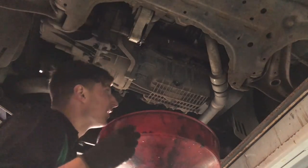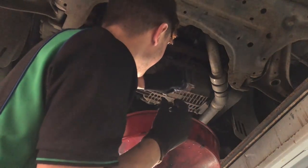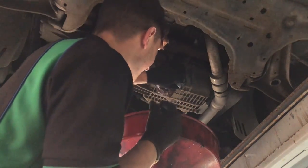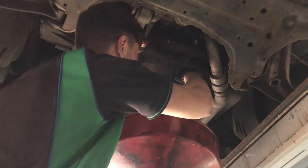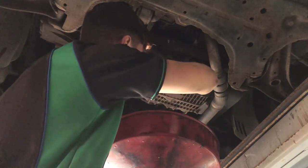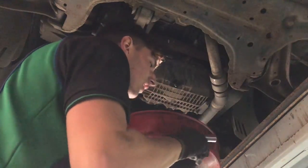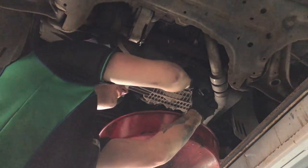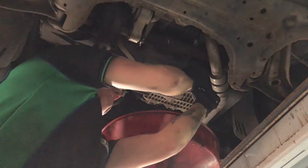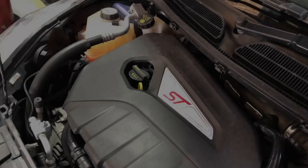You can get liquid buffer from places like Tip Top or eBay. With everything cleaned up, the oil will have drained out by now, so clean up and put the sump plug back in ready for your oil top-up. There is a torque setting for the sump plug - you can find it on Autodata or Google. I just did it not super tight but firm - you don't want to feel like it's going to snap the bolt, just tight enough that you're confident it's secure.